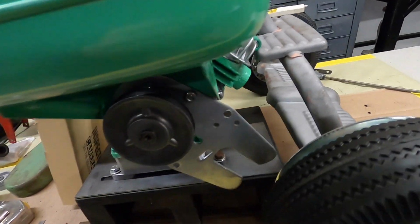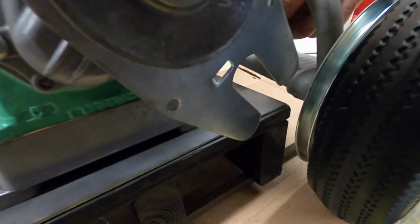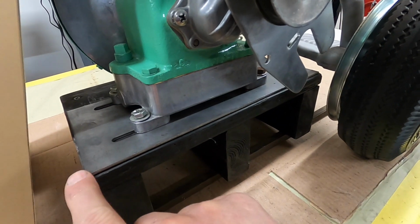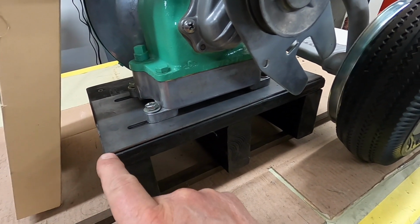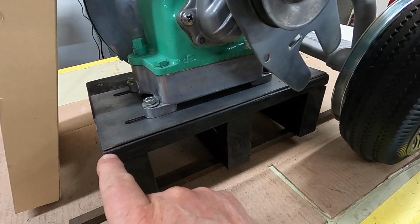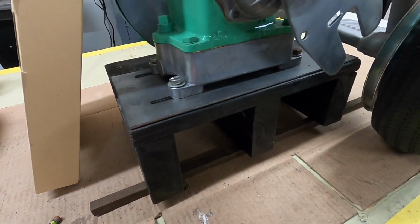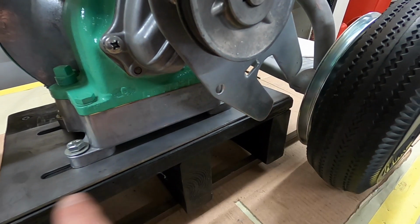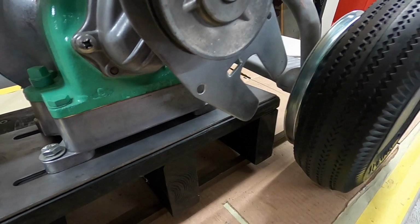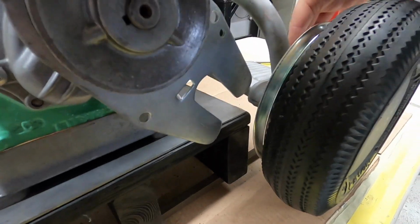I did a little measuring, so it's 3/4 of an inch from this plate to this. I made a mark there and a mark there, and it's 12 9/16 inches to the tip. So I'm going to cut this to where it comes right to the tip, and like I said, I'll have a 45 on the end of that. And then I'll have to measure the additional, so 12 9/16 plus whatever distance from this to the axle.